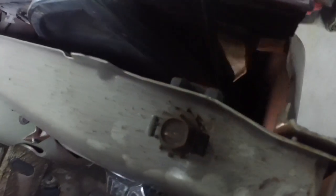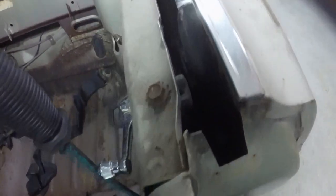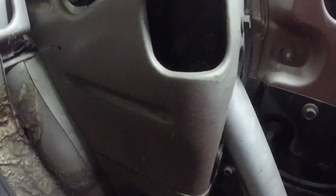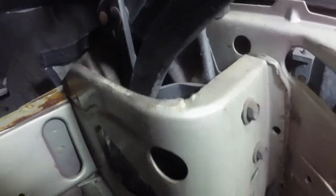This weatherstripping is down in the bottom of the door — I'm replacing all that. I can see the wiring that goes through the wire channel, probably to the tail lights, sending unit, and the gas tank. You can see the window regulator, which I'll give a good lubing. To clean that top cylinder, maybe just pop it out of there — it looks like taking it out might be the easiest solution to cleaning the piston.